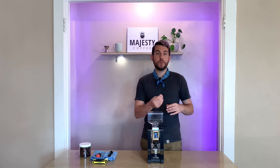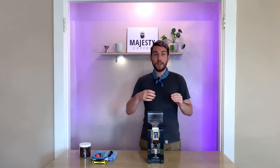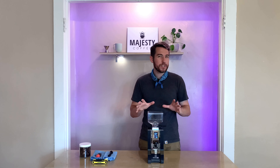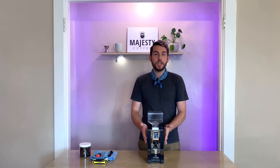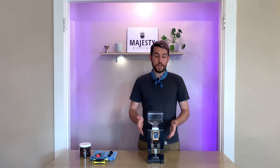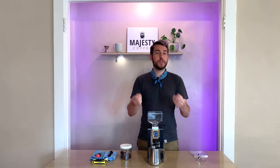All we need to do is coarsen up your espresso — give a little more space between the burrs to allow them to grind through whatever is the issue, then slowly make your adjustments back to fine again. Remember, when you are grinding and moving your burrs closer together, your machine gets hot. If you're not in a busy cafe setting, maybe use another grinder in the meantime. For the Eureka specifically, make sure you don't overheat it. If you have time, take off the topper and vacuum out the inside to make sure everything is cleaned out.